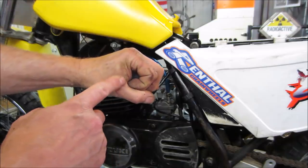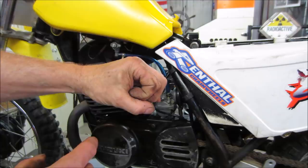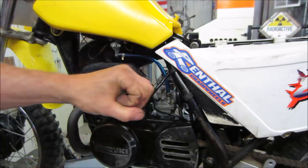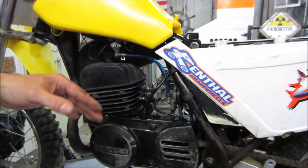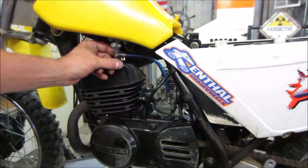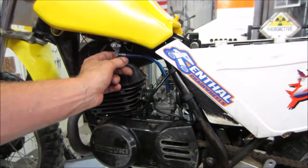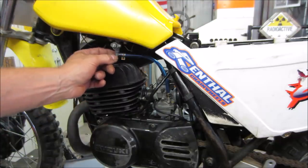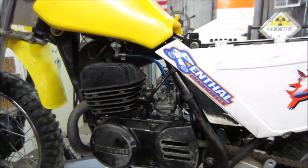With this, first of all, it doesn't crush it as bad, but over time, if it does get a little bit of play in it, it still takes that gap up. It constantly holds tension on it, no matter what the temperature that it's going through, or the life expectancy, we'll go with that. It just kind of keeps an even tension on. And then later on, too, you can take them off. You're trail riding or something, you've got to go kick some water out. You actually could just take them off with your hands and wiggle it off and put them back on.